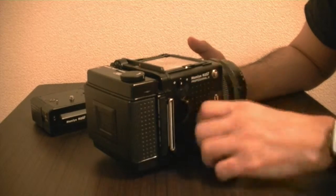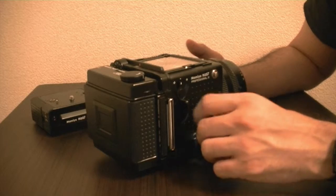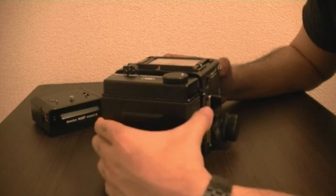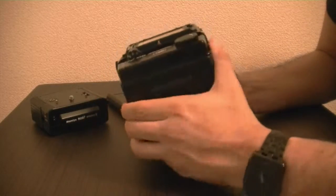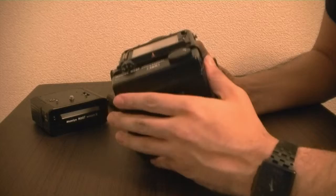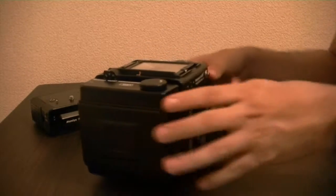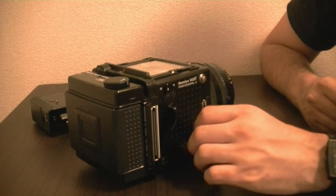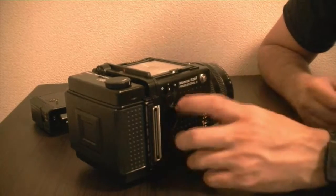So what you need to do in that case — if you see that situation where it's not shooting, not cranking — all you need to do is put it on R and just wiggle it a little bit, move it like halfway back and hop it, just like that, to make sure it's making contact. That should pretty much fix it most of the times that problem happens. I just want to put that out there.